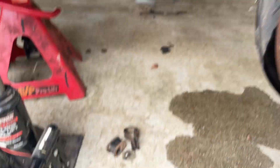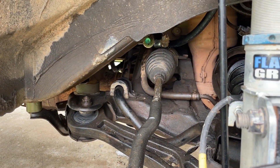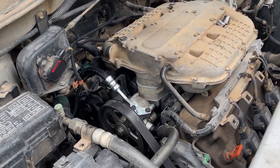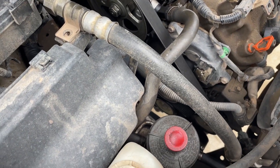The last thing I need to do now is refasten some of the different retention straps and plug in the sensor. I already went ahead and buttoned up the top and put on a new o-ring up there. So once I get all that put back together, I just need to top off the power steering fluid. I'm going to leave you there with the repair pretty much complete, and now I'm going to pivot into some cosmetic repairs as we prepare for All Wheel Drive Festival. Thank you guys for watching — I hope this helps you out. Thanks for supporting the channel. Catch you on the next adventure.